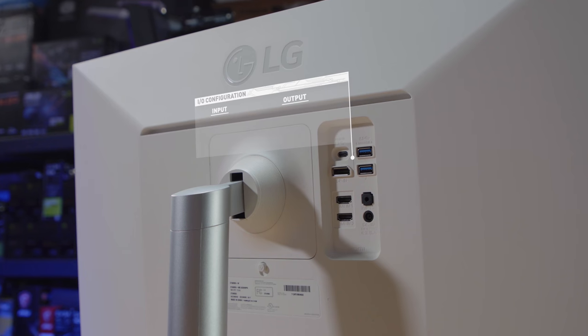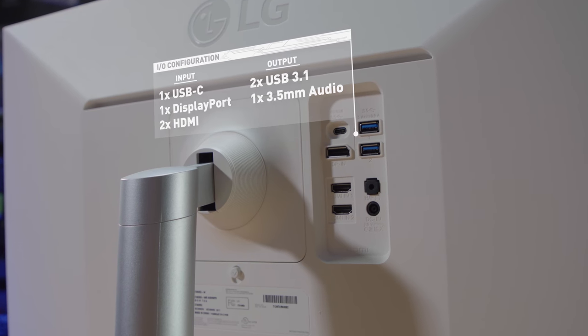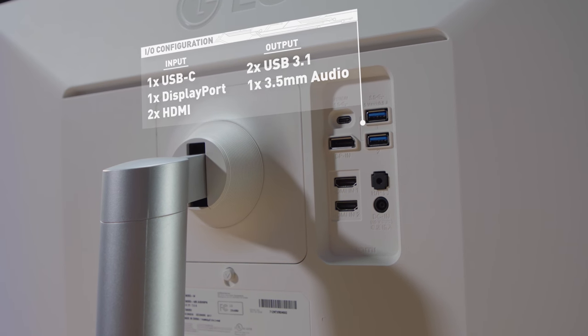In terms of connectivity, it has two HDMI 2.0 ports carrying HDR at 18 gigabits per second, so you can plug in your 4K Blu-ray player or console and your computer and still have HDR on HDMI. What you're seeing right here is DisplayPort. Both HDMI and DisplayPort carry HDCP 2.2 standard, so you can view online content without copyright issues. It's a multimedia panel with no problems playing that content.